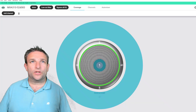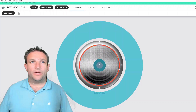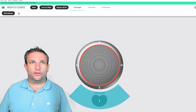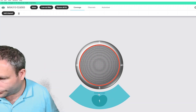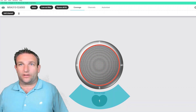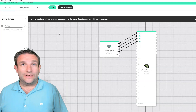Double-clicking on the microphone array shows the pickup pattern. You can select specific areas of the room for the microphone to utilize — for example, if it's in a certain area, you may not want it to use the full circular pickup area. You can change the pattern: omnidirectional, cardioid, and so on — just select which area you want to use and drag and drop it. The device has a small Shure logo so you know which direction it's facing. Simply position the pattern to match the microphone orientation. This feature works the same across whichever microphone array you use.